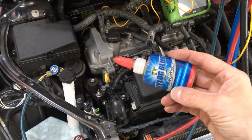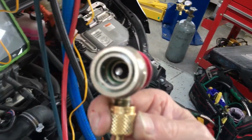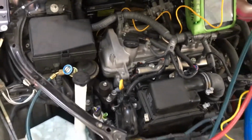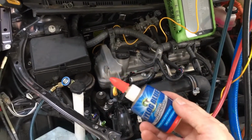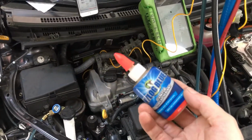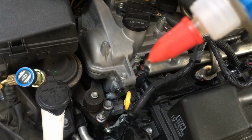So a little Nylog, it could be Nylog blue, Nylog red, whatever. You want to protect these O-ring seals that are inside here, and sticking them on dry fittings is not always a good thing. Multiple times over a dry fitting will put little scratches and cuts on your O-ring, so you don't want to do that. So every several applications, keep them well lubed, other than with oil. This is refrigerant oil, but think of 2000 viscosity refrigerant oil. That's all it is. So as you can see, it comes out right there like a booger snot.